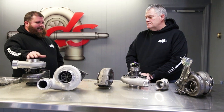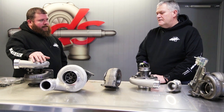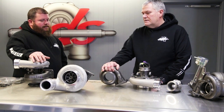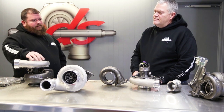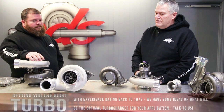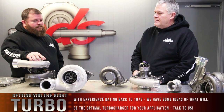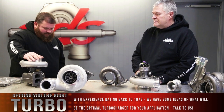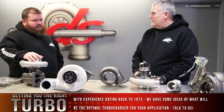I want an S366. What have I failed to tell you? That doesn't specify the turbine side. That doesn't specify the turbine exhaust housing size. That doesn't describe the outlet style of the compressor housing you're looking for. More importantly, you're asking for something that is certainly runnable on an engine, but it may not be optimal for that engine. Give us an opportunity to get some information from you. We're not trying to say that's not what you need — we're trying to make sure it is what you need before we just send you a turbo and you're upset that it doesn't spool up fast enough or doesn't do whatever you wanted it to do.